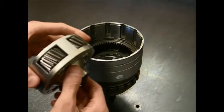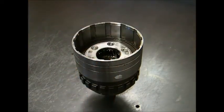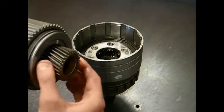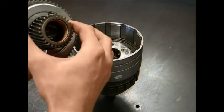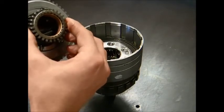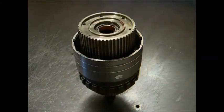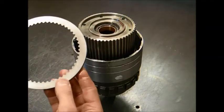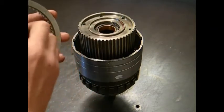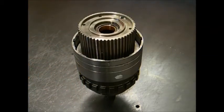After that has been completed, you may reinstall the planetary. After that, the overdrive sun gear and hub assembly with the new bearing pre-soaked in oil with the inner race lip facing down. Then you may reinstall the backing plate for the overdrive direct clutch with the recessed area facing down, and then alternating